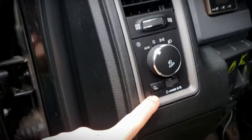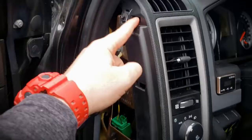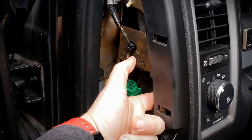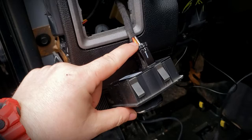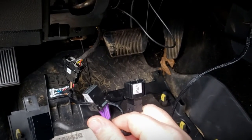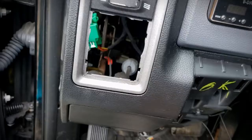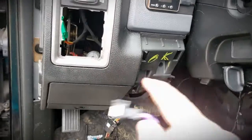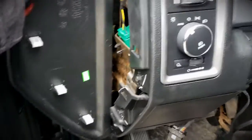Now we have to move on to our headlight switch, and to get in there we need to remove this side cover. The side cover has five push tabs — just take a trim removal tool, stick it in there, pry it out, and all five of them will pop out. You're actually going to reach behind it and pop this whole thing out because it's almost impossible to get to from behind. After your headlight switch is popped out — it literally just pushes out, all it has is these little springs holding it in — unplug the back of it and we're going to piggyback it into the harness using VS7 and VS8. VS8 plugs into your factory headlight switch plug and VS7 plugs into the back of the headlight switch. After you get that done, you can reinstall your headlight switch and the side cover.